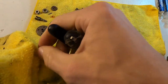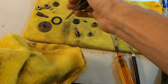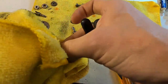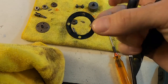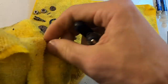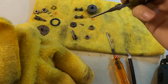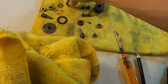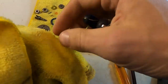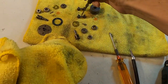Now, things that I look at as far as replacement: I make sure that the gasket is not torn. As long as it's still looking good and not tearing, I'll keep using it. O-rings do swell a little bit, but even when they swell they don't seem to cause it to leak at all. I haven't noticed any difference in performance, so generally I don't change the O-rings too often on these — but that's a play-by-play depending on what vehicle you are racing and what you're running.